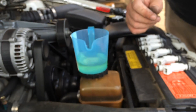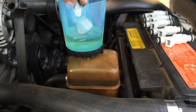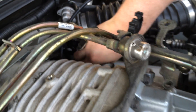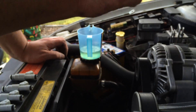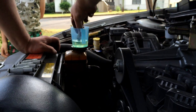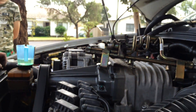Some of you might be wondering why I kept that fuel out. Scotty Kilmer from ScottyKilmer.com suggested that we lubricate these rings - it's really just dipping the rings in the ends - and he reckons you'd get a better seal. So I'll just push the injector down inside there. I'll do another one when we come around this side. This one goes in the hole and just push down inside there like that, that's it. There, pushed in - hopefully they're sealed.